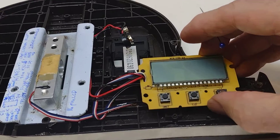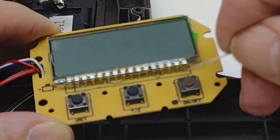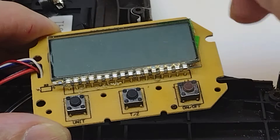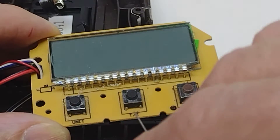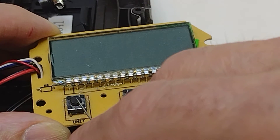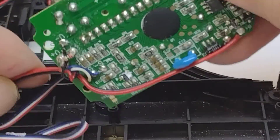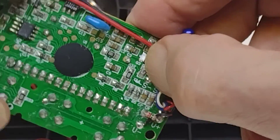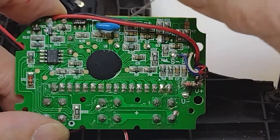Let's have a look at the circuit board. If we turn it over, we've got a single-sided circuit board. There we have the three switches along the bottom: the on/off switch, the tare switch — so if you put something on the scales you press that and it zeros them, meaning you're not weighing the pan — and then the units switch for kilograms, grams, etc.